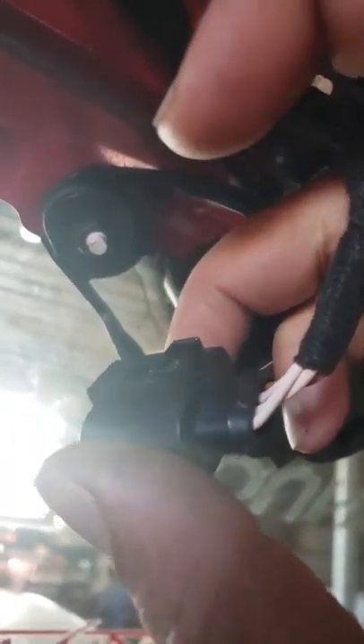We've just got three bolts holding up the motor. We're going to take this clip off here — it's a push-pull connector on the motor. What that means is you push in, pull the tab, and then pull it off. It sounded like it broke, but it didn't. And it appears those are 10 millimeter bolts.